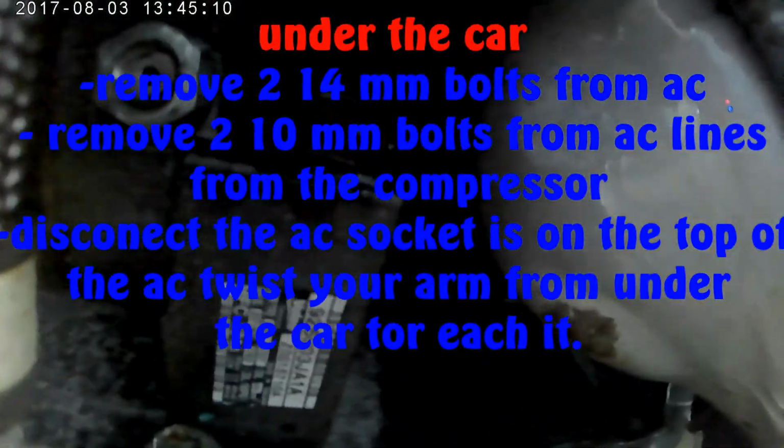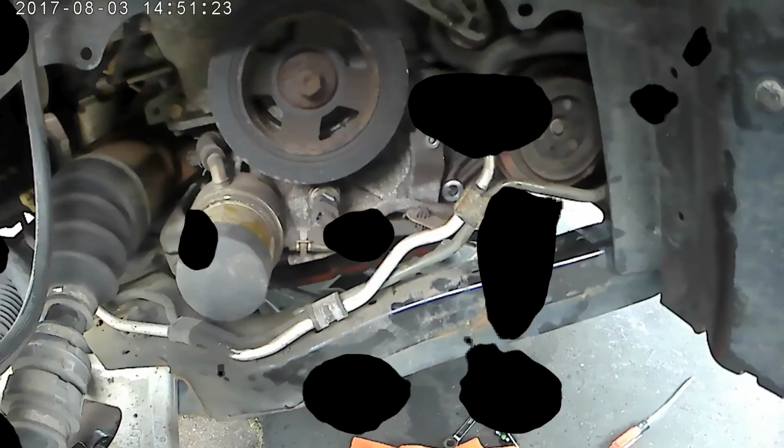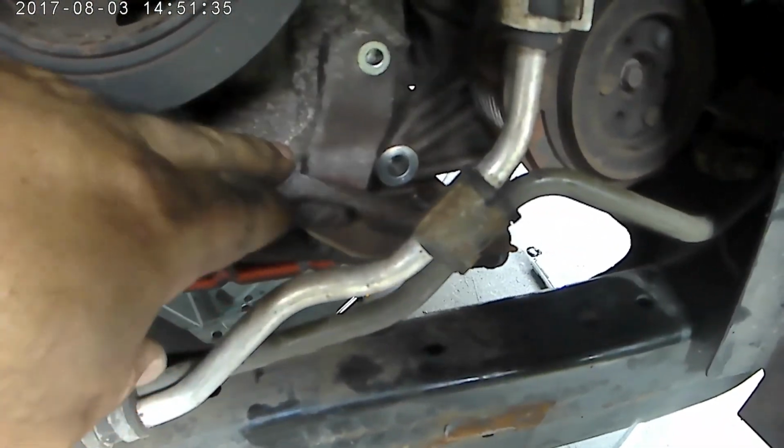Then you need to remove the cover down here, and then you have another bolt over here and another bolt up there. So I don't know if you can see. And then you need to remove the AC lines, which are over there, two over there. Okay, so those are 14 millimeter bolts over here. As you can see, I already removed that. And so in order to have access to the bottom bolt, you need to remove this one. And there is another bolt over here, 10 millimeters,